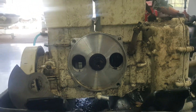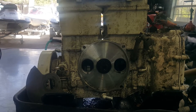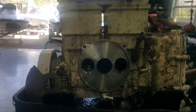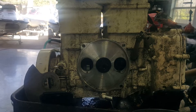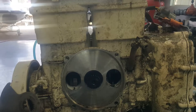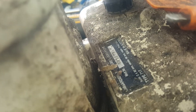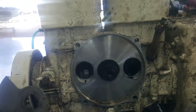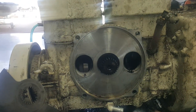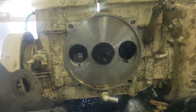Today we're learning to time your two-stroke Sea-Doo C2 engine. This applies to all the rotary valve engines — it does not apply to the 951 because that is a reed valve engine. First, you want to find out what type of engine you have. You can look on the front plate — you can see this is a 717. Then go online or in the manual and they'll give you a timing number. This one happens to be 147.